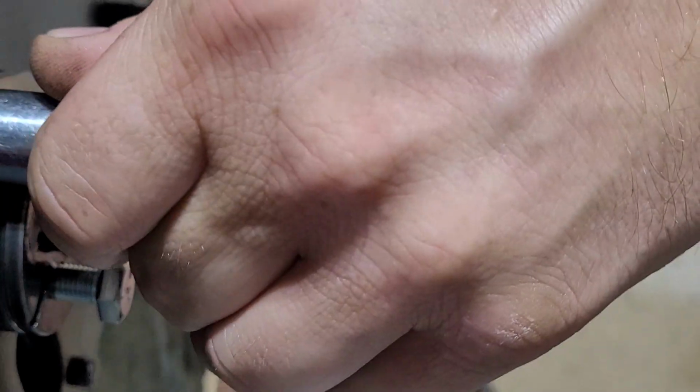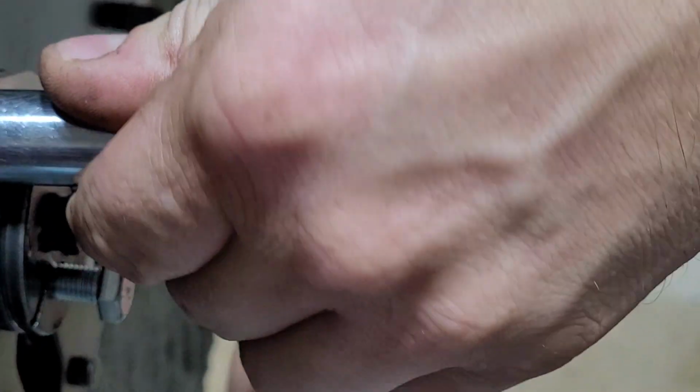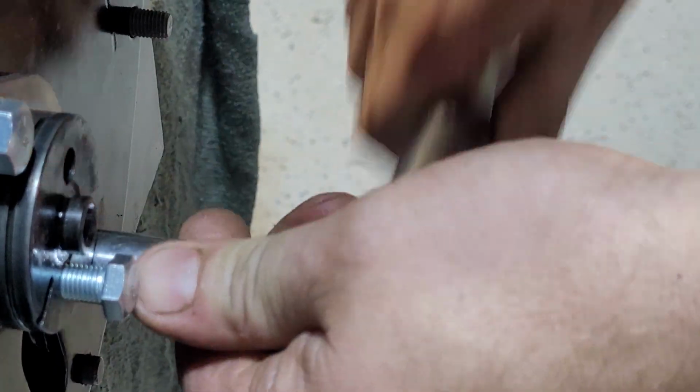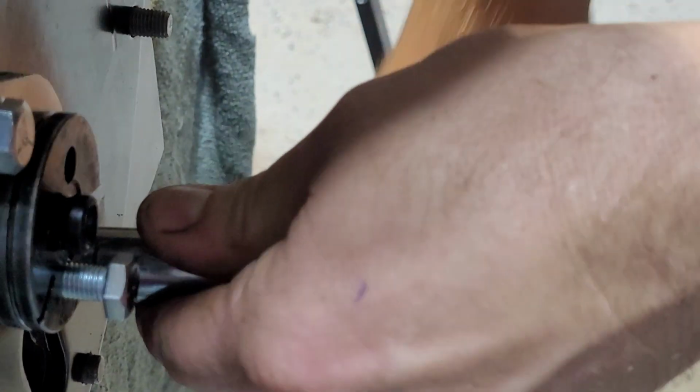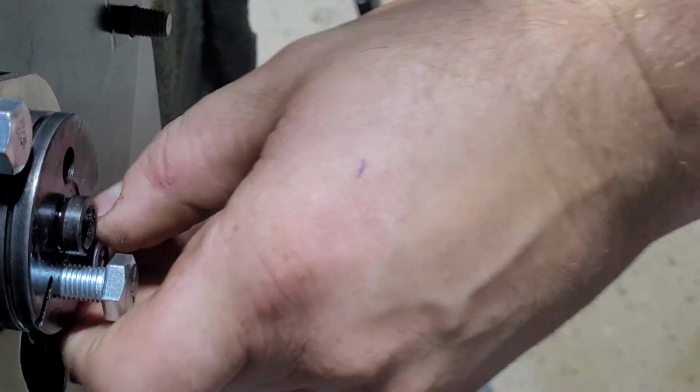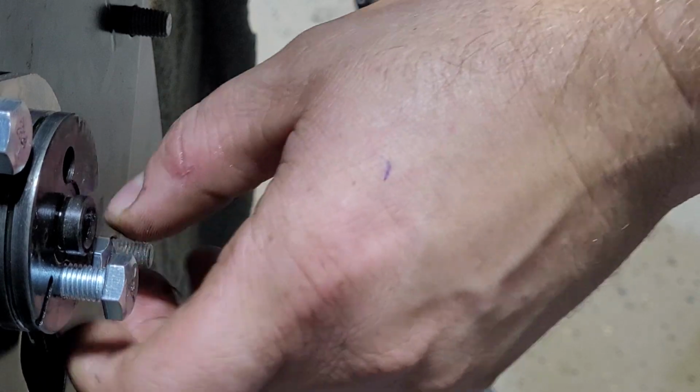And hopefully this should be the last time. Again, you have between 4 and 6. So if I did all that grinding, what did I take off? I had less than 1, and after 3 I only took 2 tenths. Well then, if I grind the same amount again, I'd take 2 and I'd be up to 5. Perfect.